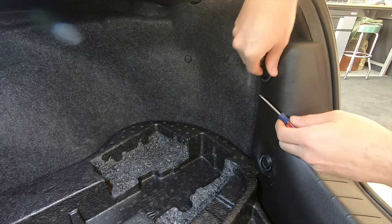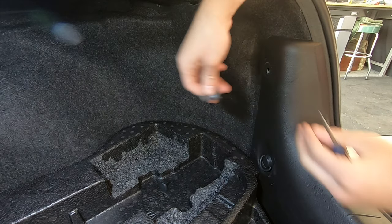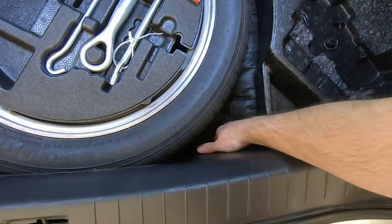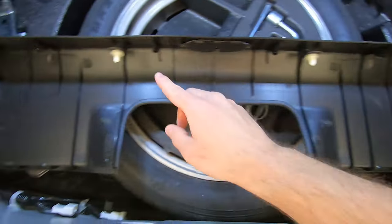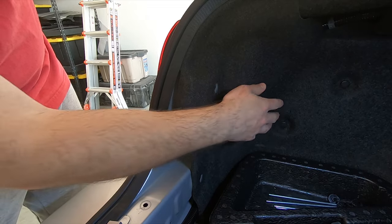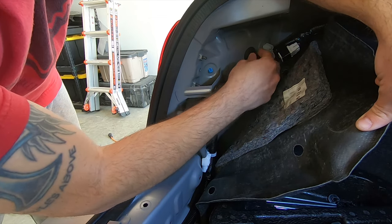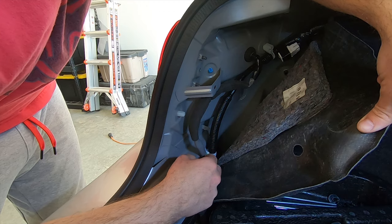To remove the shroud there are four clips that need to be removed. A screwdriver into the back, pop it, center comes out, clip comes off. Once those are out, this panel is held in by four pins. By grasping at the bottom and giving it an upward tug on each side, that slides out all four pins intact. Now there's not too much you need to worry about after that — the only thing we need to get to is right here, this first plug wrapped in foam that goes to your tail light.